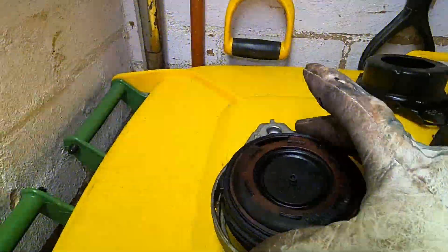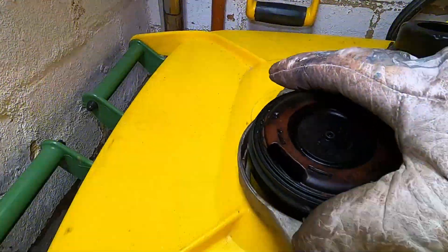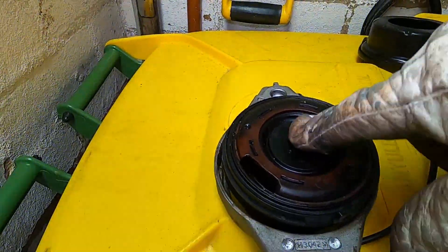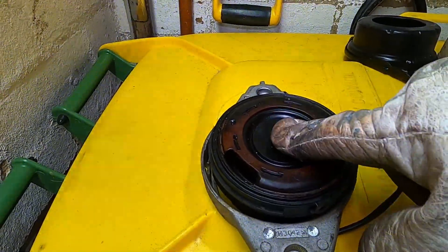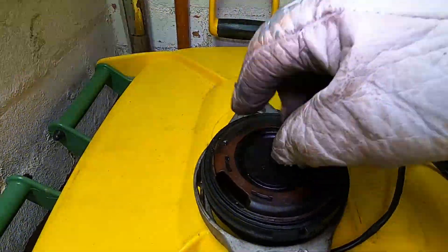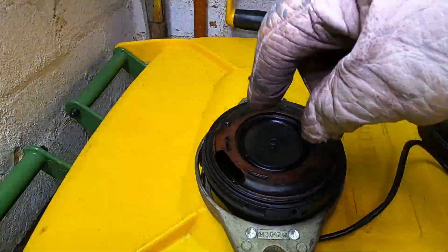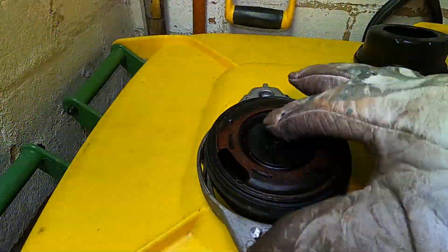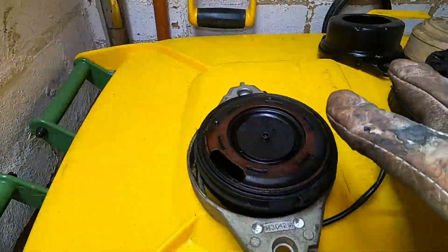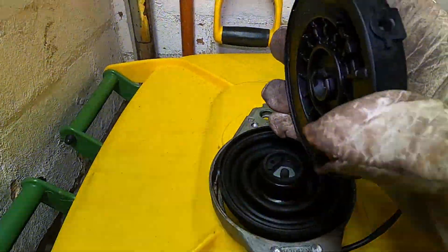Underneath that is this separation ring - it's pretty special and a bit hard to work out what's going on. There's a fluid reservoir down inside here and then this center disc is loose, which allows as the engine vibrates for it to lift up and down with the fluid. Because the fluid is non-compressible, the fluid goes up and down, this goes up and down, and then depending on how this is controlled it creates variation in the vibration absorption properties.